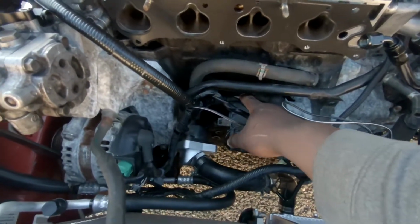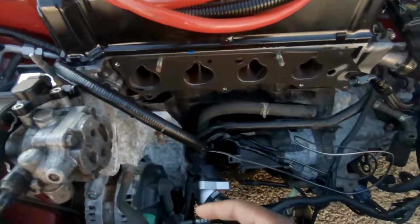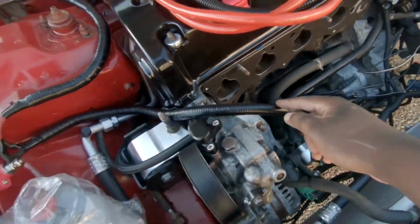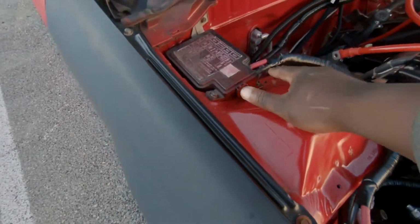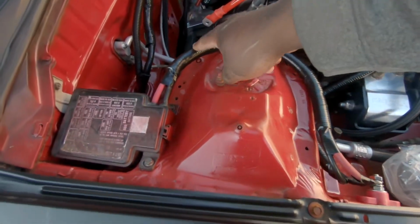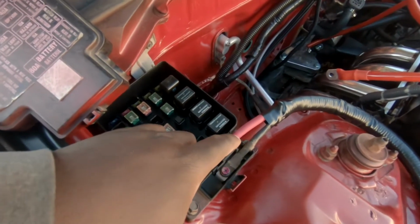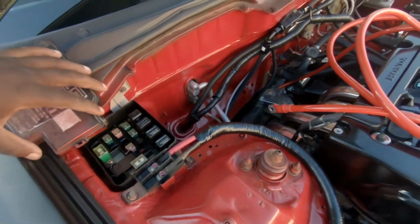This wire, however, runs straight up, straight to the battery post. And then this wire here on the alternator is going to run to the fuse box. So as you see, I tucked it, reran the harness. It's going to be running through here, makes a fancy little bend back into the fuse box, but I also needed power to go to the fuse box, so second one, wrapped it, taped it. I reused this connector from the stock K-series harness, and then I made this one. This is 4 gauge, and I believe OEM uses 4 gauge. I've got welding wire. Seems to fit the bill.